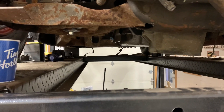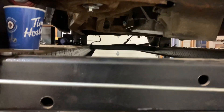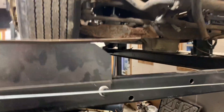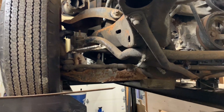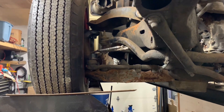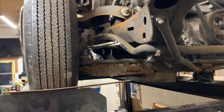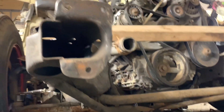The tranny needs to go up a bit higher, just compared to where it's sitting on the rear end. The rear end is hitting the body right now. So if I tried to air this out — which it will be getting airbags — it's going to hit the body even more. So I need to tunnel that and get it all fixed up. This is actually sitting a little bit low in the front, but basically that's where it's going to be sitting. The airbags are a little bit too flat, but it'll be up just a touch. Everything is lined up real well — I'm happy with that.